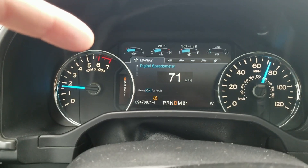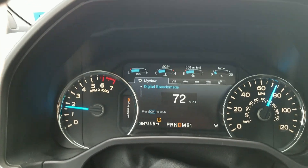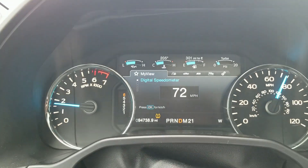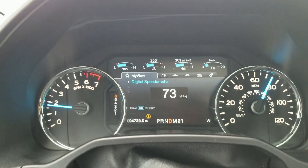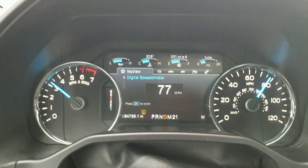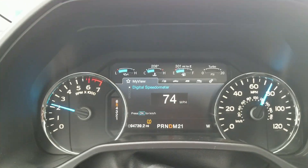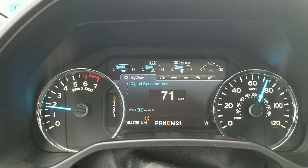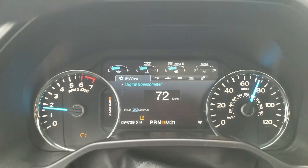Welcome to another YouTube video. Today we're going to figure out what's going on with the truck. Let me show you what happened on the road earlier. Ignore the low tire pressure — we just had a bunch of cold weather and I need to add a little more air to the tires. Check out what's happening right now: the truck is working pretty good just cruising, but if I step on the gas and try to accelerate, it's not picking up well. The check engine light flashes and the truck feels like it just lost power to the engine. Then you cruise for a little bit — the truck is kind of shaking a little.